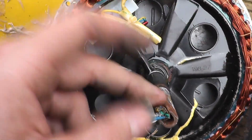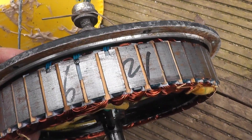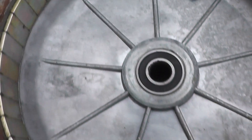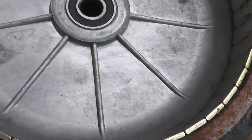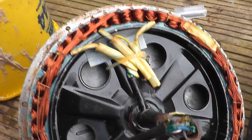Unfortunately she is bad — I'm going to need to replace this cable. The whole sensor is just there. The condition actually looks alright in here, it looks really good in here not going to lie. The bearing feels smooth, a little bit of debris, but there's nothing — no mega chipped magnets or anything like that. Not bad at all. No burnt windings that I can see.